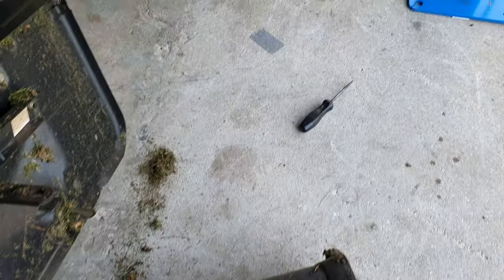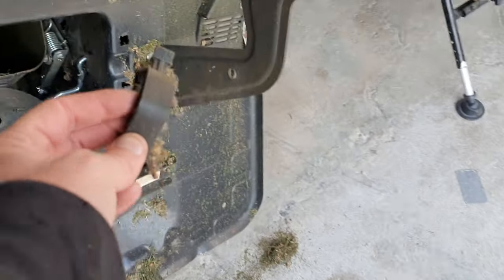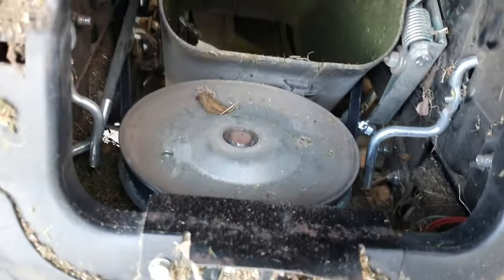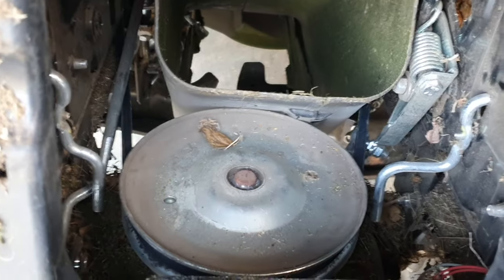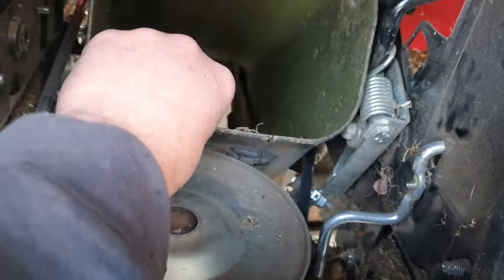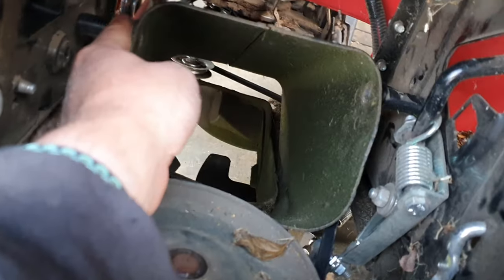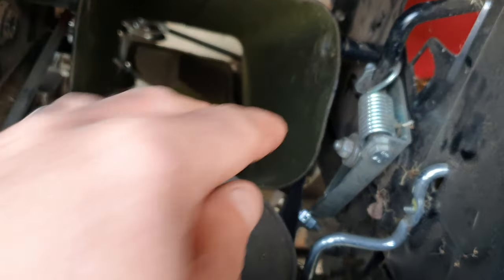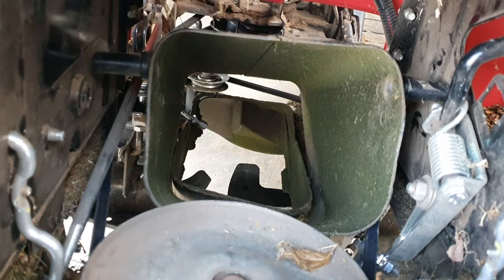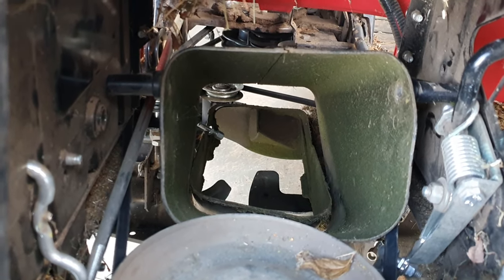Then you need to get round to the back and remove the back panel, which is simply these two clips here. That will give you a view of the pulley on the gearbox. In there you've got this component connected to the edge on each side, and the belt goes under that, so you need to undo that. It also makes it a bit easier if you can move that around when you're doing the belt.